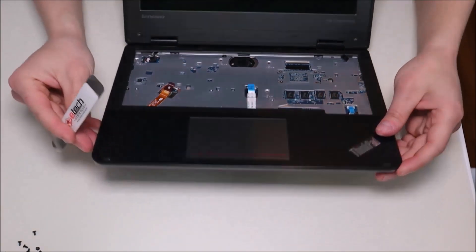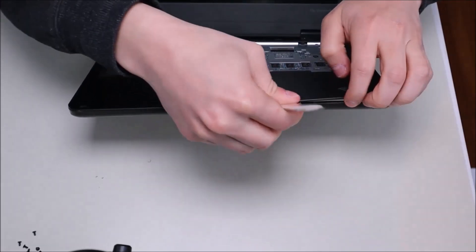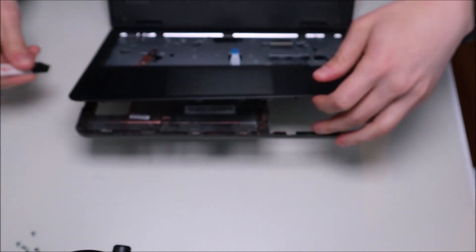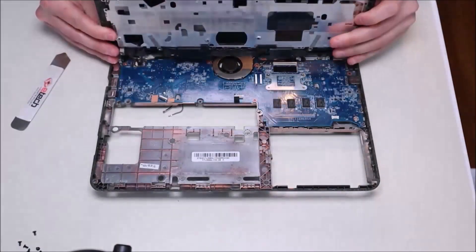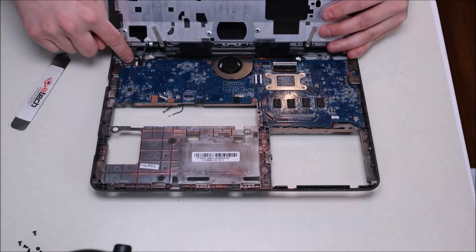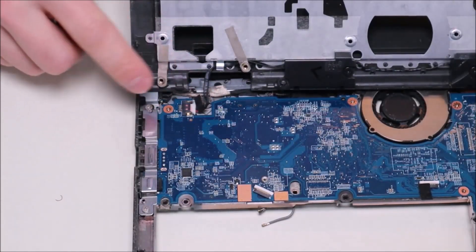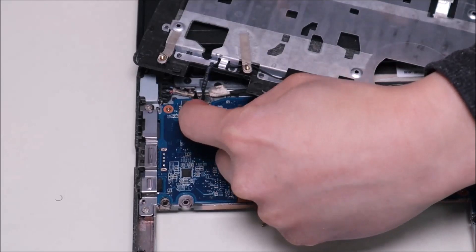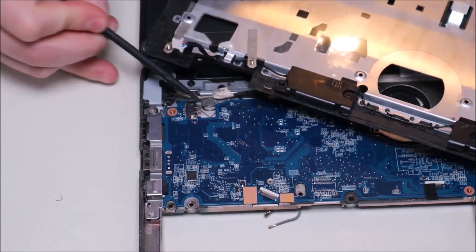Now that all three of those are out, I'm going to take my metal pry tool, go around the seam of the palm rest and the bottom case, and gently pry it up. Be careful not to go too far in as you could damage some components. The palm rest is now loose, but if you flip it over you'll see the speaker wires — those are still plugged into the motherboard so you can't just rip it off. I'll zoom in on that port and show you how to disconnect it. This plug just plugs straight into the port — no clasps or clips. Put your fingernails on either side of the white port and pull out, or use the flat end of your pry tool and just push out like that.